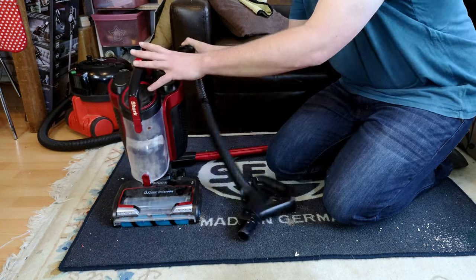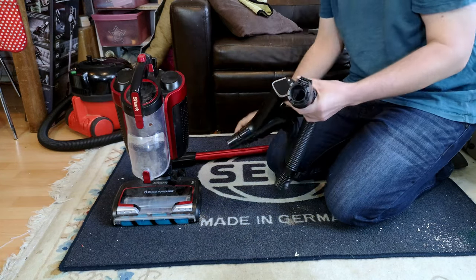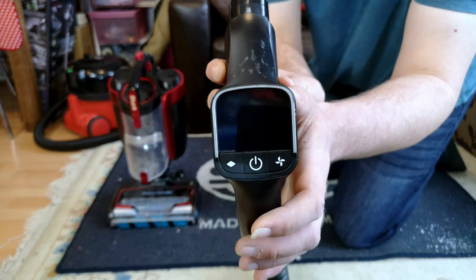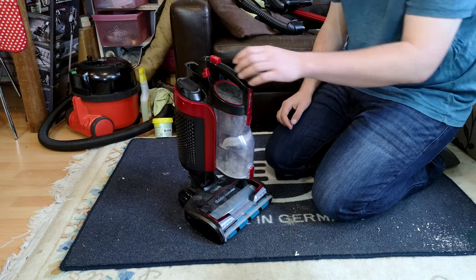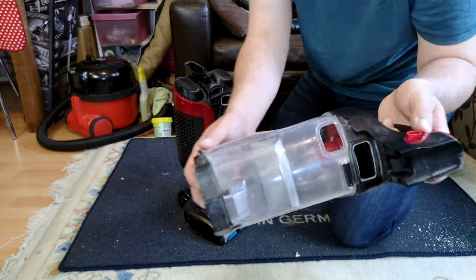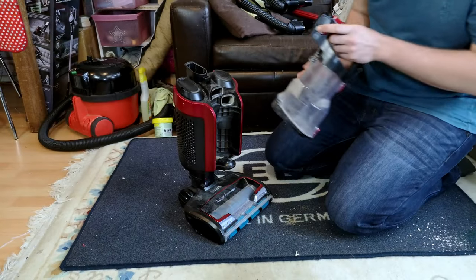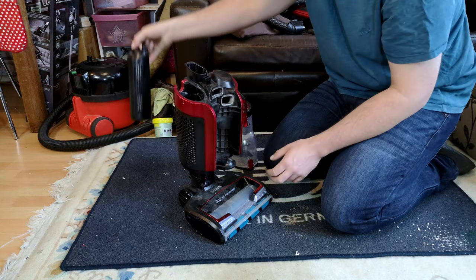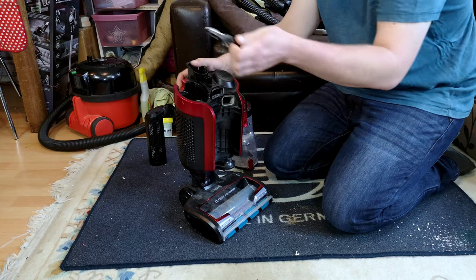She's not a happy bunny, but I don't think our problem now is in either of those hoses, which is good. So we can take it apart — we'll have a closer look at that when it's not throwing errors everywhere. We need to look down here at the dust cup — that sort of is our problem, because look, the shroud's doing what Sharks do and getting all clogged up. We have a leaf in there — very nice. We'll take the battery out as well to be proper about it, and then we'll have a look at the post-motor filter.